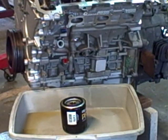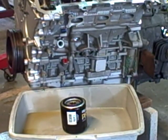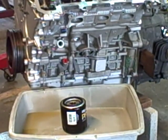The oil pump is in the front cover on the engine, and it came with the oil pan installed. Of course it had the warning stickers about priming the oil pump — the usual stuff, that's common. But in this case I can't prime the oil pump without pulling off the front cover.